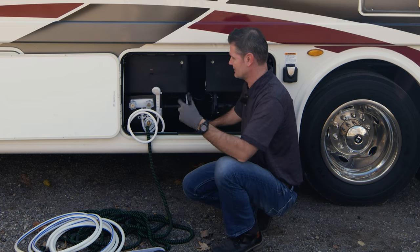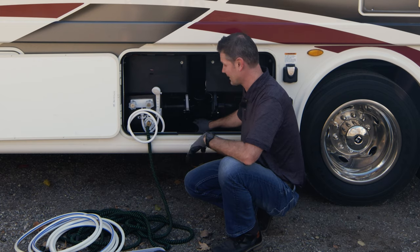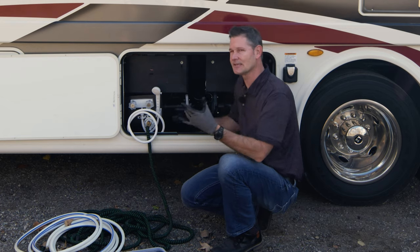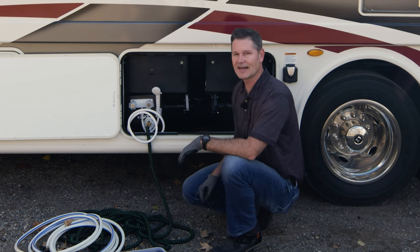This exterior shower is a great option — not only for washing off dirty pets after they've been swimming at the beach, but also for washing mud off bikes from a trail you just discovered, or washing your feet, whatever it may be. You can also spray a little water down into your sewer hose to make sure all the water is out. Store the sewer hose in a little plastic tub — because we have so many storage bins on these Hurricanes and Wind Sports, store it wherever you like. A plastic tub is great so if there's still some water in there, it's not going to get into the bay. Twist the cap back on, lift the hose up, and you have just flushed and dumped your tanks.